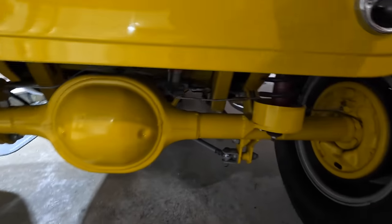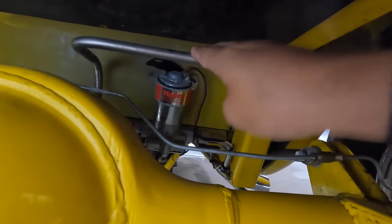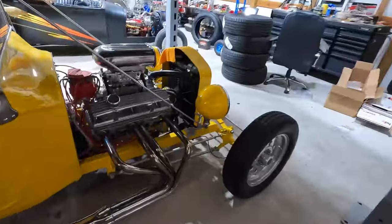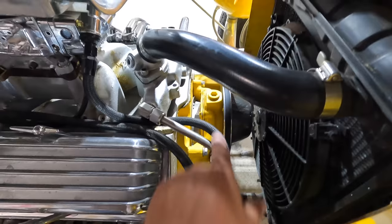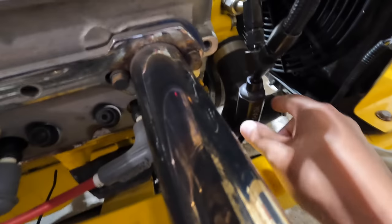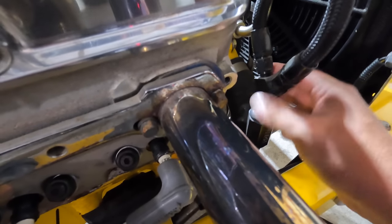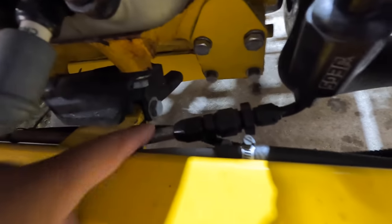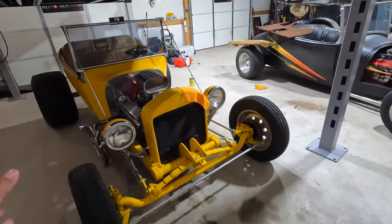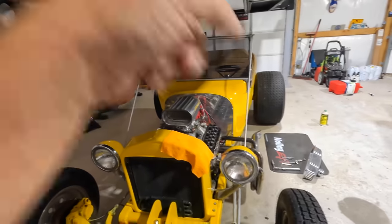Underneath, take a look at the suspension setup. You've got a big Holley fuel pump right there. All this hard line plumbed in — that is insane, absolutely insane. And in case I wanted to hit up Holley to see if they could send me a Sniper kit for this — guess what, it's got AN fittings, dual feed AN fittings to the carburetor. You've got a T down here from JEGS — I believe that's a fuel filter with a splitter on the end, and it comes out of a hard three-eighths inch fuel line. This thing is ready — you would have to do almost nothing to drop a Sniper in.